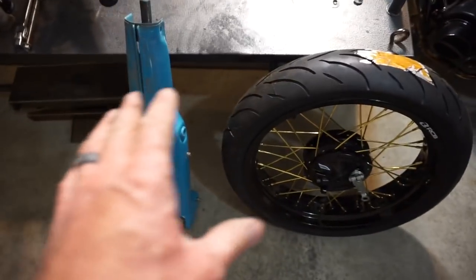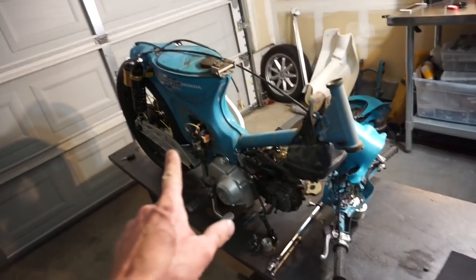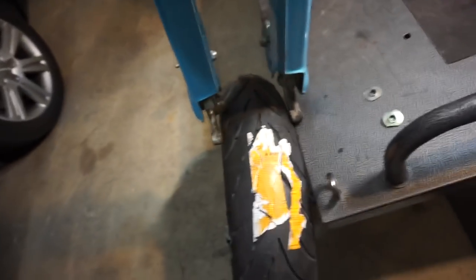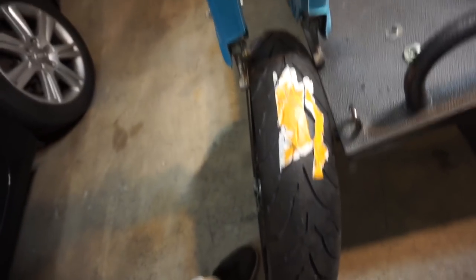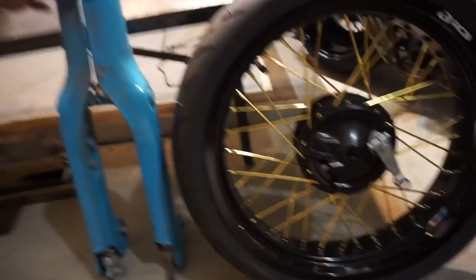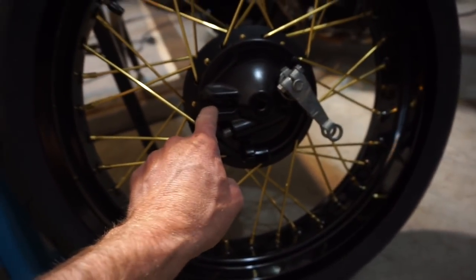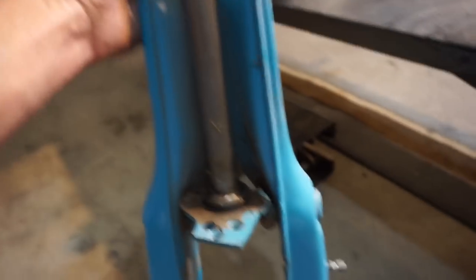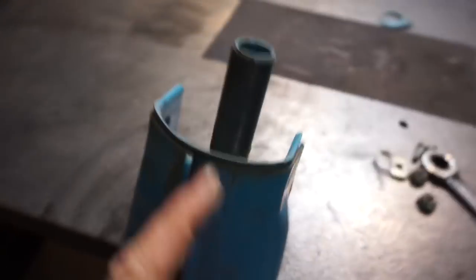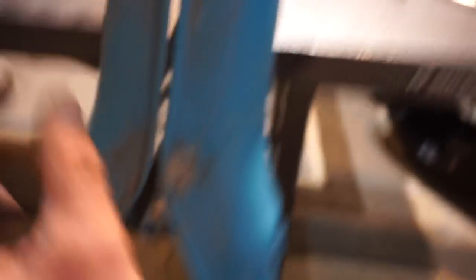Here's the dilemma. This is the whole reason why this front end is off the street cub — this wheel needs to go on this street cub. See how wide this tire is? And see how wide the front end is? That doesn't work. Need to go slightly larger. But you can imagine how sweet this is going to look once it's done. The stock hub — everything's stock. We'll just have to put some spacers in here. What I need to do: this piece here that's attached needs to be cut there, and this guy too also needs to be cut. Then I need to add a piece to widen it.